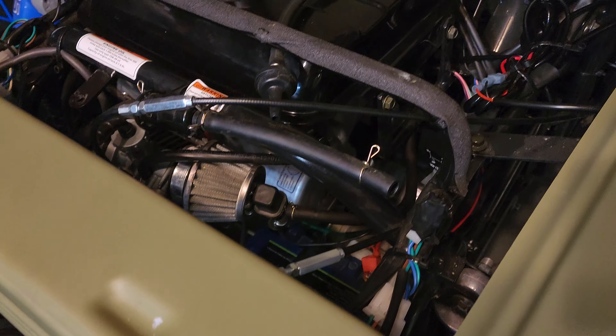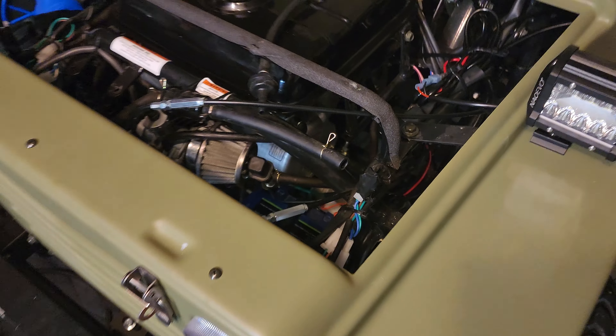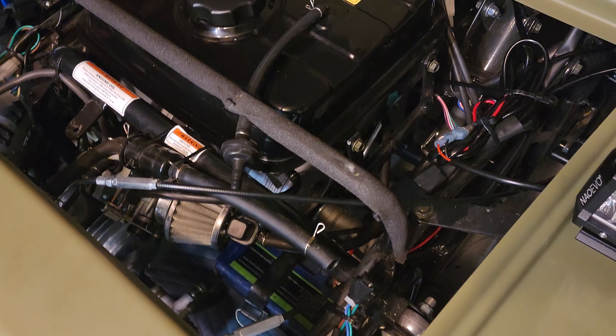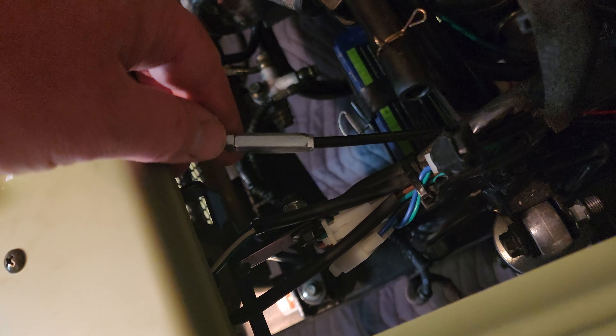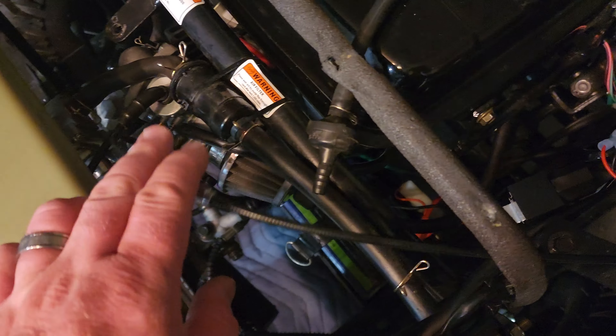With the fuel line — I got a new piece coming in the mail tomorrow hopefully, it'll fit a little bit better. This one's kind of stretched just a tad but it works for the time being. The routing of these cables is kind of goofy and a bit sensitive. You can see there are adjustments here for the throttle, and this one's the choke. You've also got a pod filter on there which you can clean every three or four rides — oil it so the dirt doesn't stick.